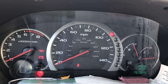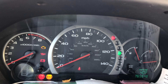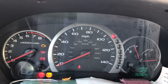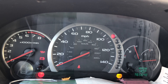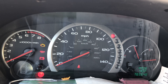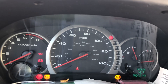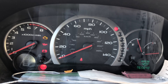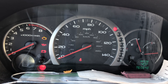I have this little cheat sheet I got from a website that's supposedly going to tell me what's wrong with my car. Without the paperclip trick I wouldn't be able to figure out what's wrong. So for code 26, it says my third clutch transmission fluid pressure switch — short on/open off — needs to be replaced. I replaced it in one of my other Honda Pilots; it's about $50 or under.